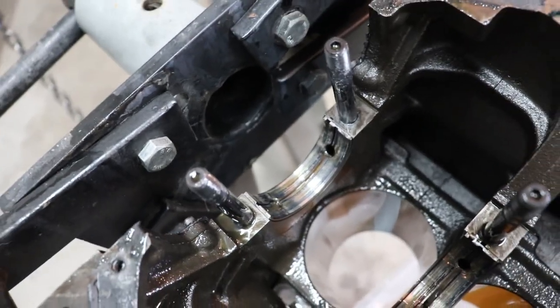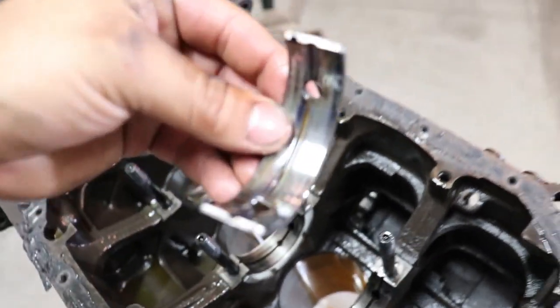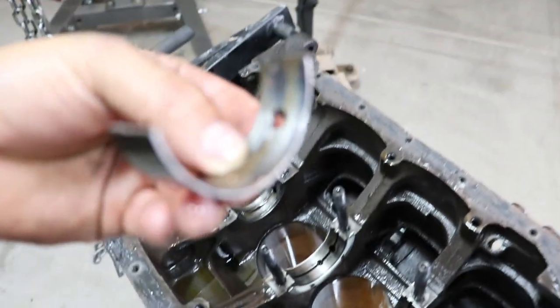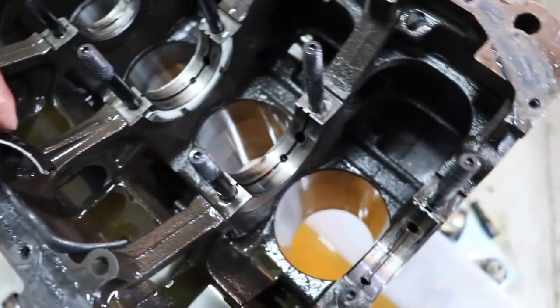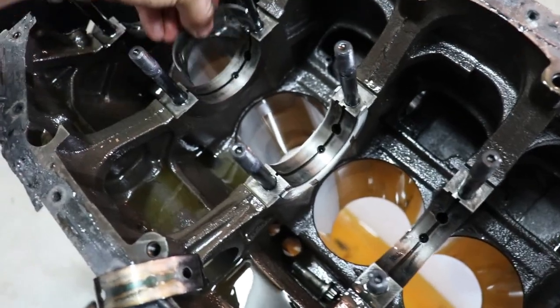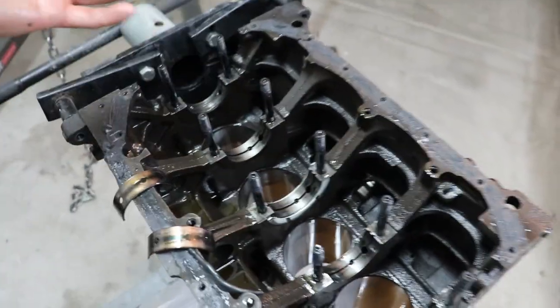Main bearings — oh my God, those things are horrible. What did we do to this motor? Luckily it didn't damage the actual block. Look at that — that's insane. You can still see part of the metal shavings just resting inside there — those are the copper pieces. We'll fix it, we'll make it brand new again. Just so you know, I don't have any oil squirters — I blocked them off with allen bolts because I saw bad things happen with oil squirters breaking off and losing oil pressure. But regardless, we spun a bearing anyway.